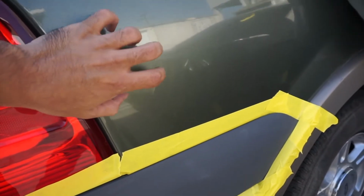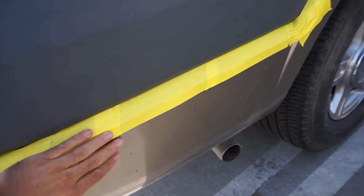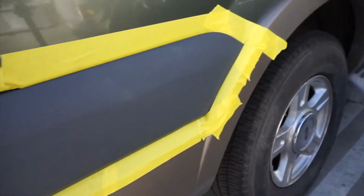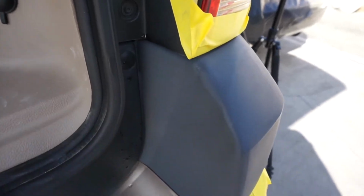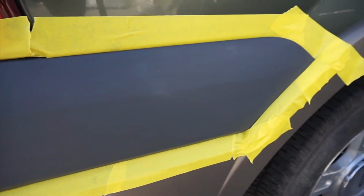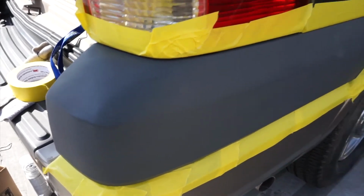Alright, so before any wet sanding or filler or anything goes on with an abrasive, I'm just gonna make sure that the actual panel is protected, the light, bumper, and the flare. I'm not really gonna focus too much in here. I'm just gonna pass it real lightly. I don't gotta watch out for this or up here or anything, but definitely this light. But yeah, so I'm just gonna go over it with a 400 grit and a little body filler, and it should be good.